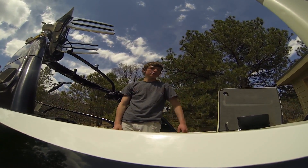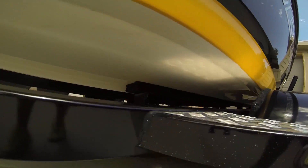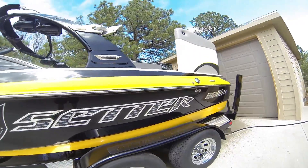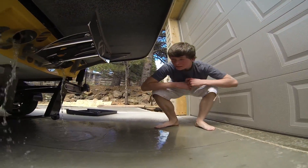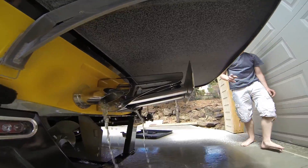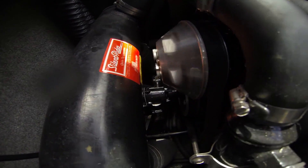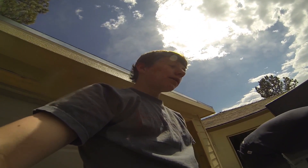We've got the fake lake set up, so we're just going to see how the impeller works. It looks like we're doing pretty good — we've got water coming out of the exhaust, which means the water is getting pumped up pretty good. Everything's looking pretty good. Let's check the engine just to make sure. There's really no leakage in there. If you put your hand under the impeller, you won't be able to feel any dripping. It seems like a success.